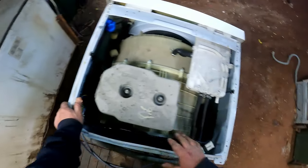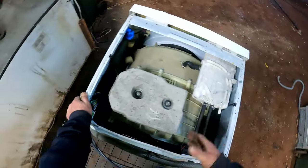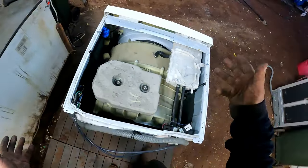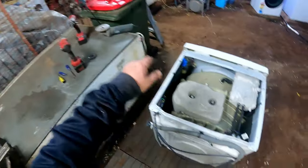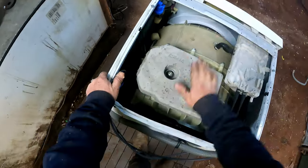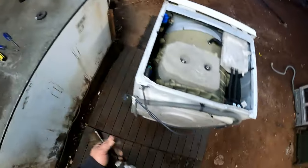What we have to do, before we even think about laying it on its back, is take the back off, disconnect the cord, take photos so we can reference where things go - because it could be a while before we know what's going on. Taking photos of where wires go is the best way to do things. The whole drum will probably have to come out anyway. We've got to undo a few hoses, take the front all off, and even winch the thing up in the air to get it off the suspension rods. We'll also take the concrete block off as it's just extra weight.